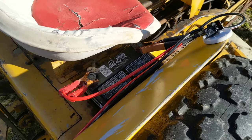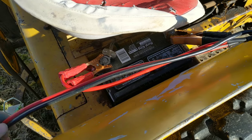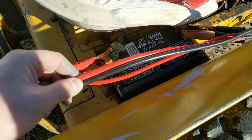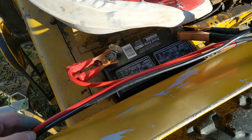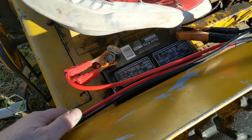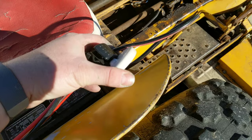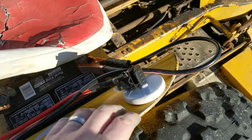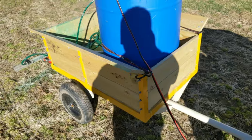The other thing I did is a little bit redneck, but I was kind of in a hurry and honestly I might just leave it. I picked up some cables — they were at a sale, these are jumper cables and I think they were like two dollars and ninety-nine cents. They're only 10 gauge — the plastic is actually way thicker than the actual wire — but they're 10 gauge, plenty for this little pump. I can just clamp these cables right onto the battery and then I have a little switch that's mounted to a magnet; I can just pop it on my fender and now I can control the pump on and off from the side of the fender.